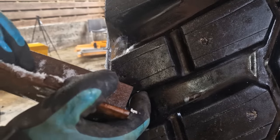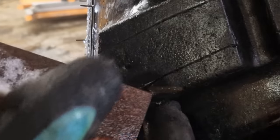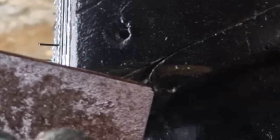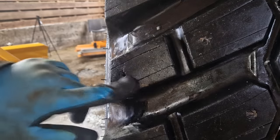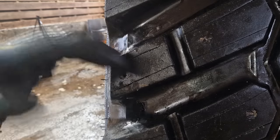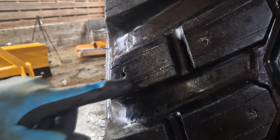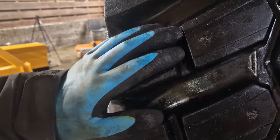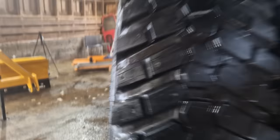This siping right here — when you're driving, the slits open up like that, and that provides just so much more traction. It's incredible how much that helps. So if you have tires like this on your tractor and you're driving on snow and ice, making these siping slits is going to help so much. And obviously if you do that and stud them, then you have proper winter tires.